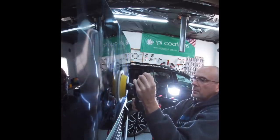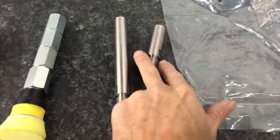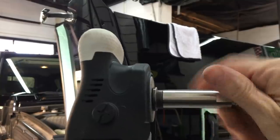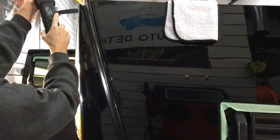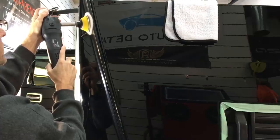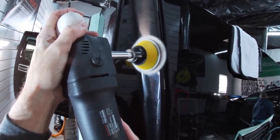That will take care of the large flat surfaces. There are a lot of 90 degree angles, and you've seen this attachment here — this is a piece I could break down into four separate pieces and stack it up. These are extensions for the rotary. Screws right onto the 5/8 threads for the rotary, and then the backing plate of your choosing: 1 inch, 2 inch, 3 inch, 5 inch, 7 inch. For this purpose, we're going to put on a 3 inch backing plate and a 3 inch Max Shine wool pad — that will be perfect for this little contour or body line here on the hood. With a larger pad you'd only have room for a quarter of the pad surface, whereas with the smaller pad and backing plate you have the full energy from the polisher going down through the extension into the pad and doing the correction.